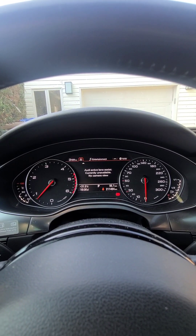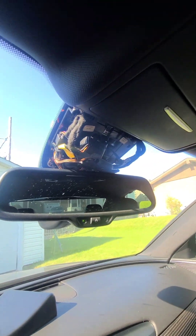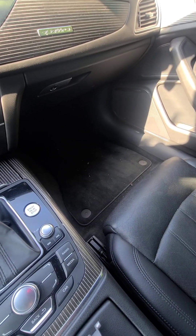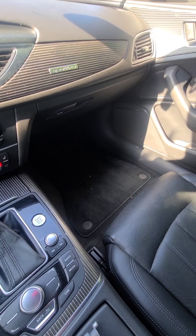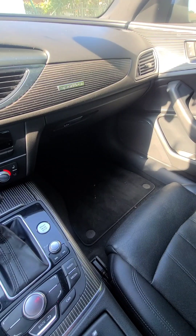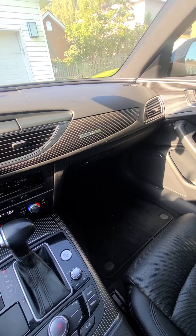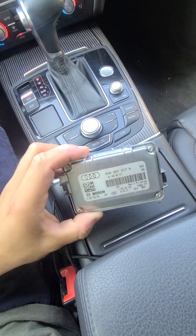From my research, this issue has been that either your front camera up here — I took this trim off — is defective. Either the cable connecting this camera to the imaging module, which is one of the two modules in the floorboard on the passenger side under the carpet, is compromised, or the module in the floorboard is compromised. The module in the floor doesn't seem to really be an issue unless you have some sort of moisture or water sunroof drain issue. The cable in some cases seems to be kind of finicky, and then there's the camera, which in my case I removed — seems to be the number one issue.